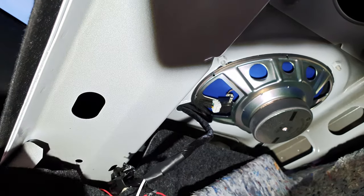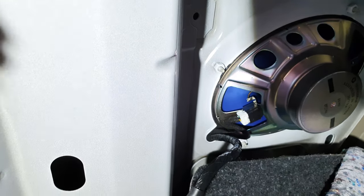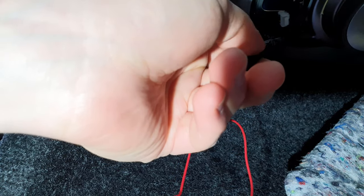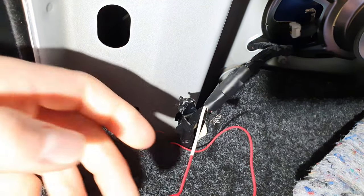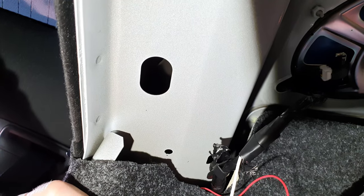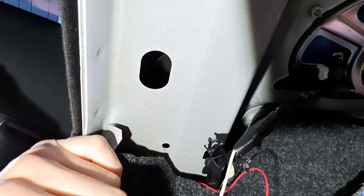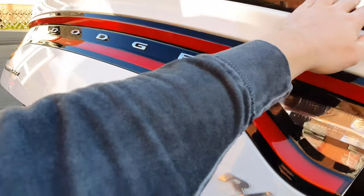The wire goes somewhere different than I expected — it goes under this cover, all the way up to the rear speaker, and from there somewhere else. I cut through the black wire cover and found the orange-white wire and cut it, so I was able to connect the plus pole from this cable. I'll now show you how the camera actually looks — I can leave the trunk open.